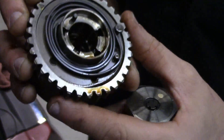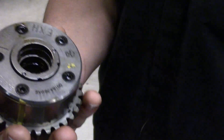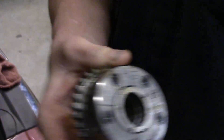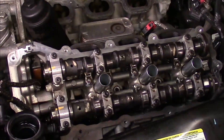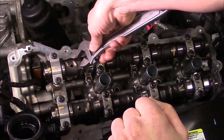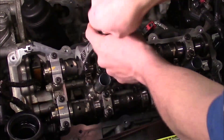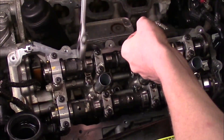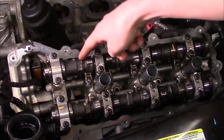When you line it up there's a little bit of movement, not a lot, but that is your alignment for the camshaft. Intake looks identical. Now the camshaft has what I call a relaxed state. The relaxed state is where the tension from the valve springs isn't pushing on it at that point. You rotate slightly towards the intake — that is pretty much the rest position for the camshaft.